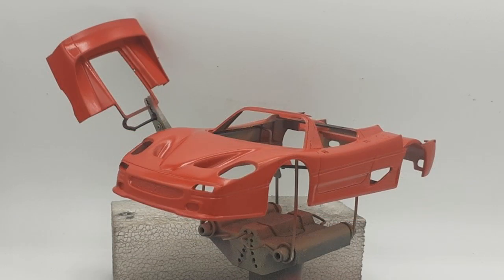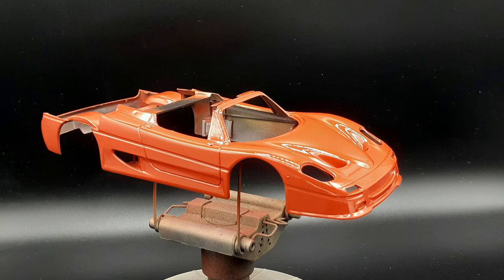And it didn't take much. The body was in pretty good shape from previous preparations. So the main coat was dry, then a color coat sanding, and then another coat to get it to the full color base. Now I'll show you how the gold underlying base has such an effect on the color right through the top coats of red in different lighting situations.